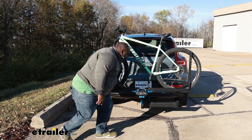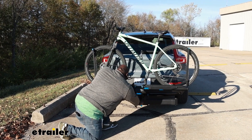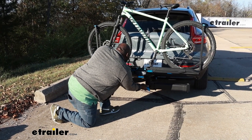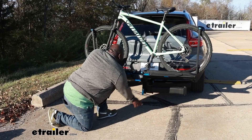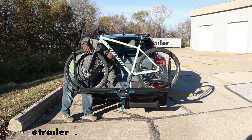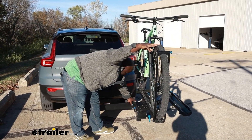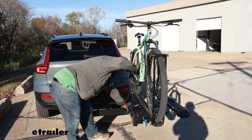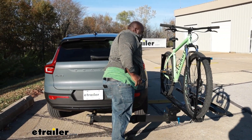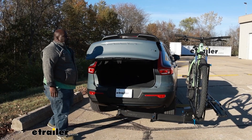One of the main features on this carrier is the ability to swing away. All the Rocky Mounts carriers have the blue aluminum handles where you'll know all your touch points. We're going to start by unscrewing this handle — this is additional stability that keeps everything secure when you're not folded away. When you get that loose, you're going to release the pin back here and slide it out. Right at the hinge, you're going to reveal another contact point, another pin you're going to pull out, and guide the rear of your bike outward — being cautious of a pinch point. That allows you to gain access to your cargo area without unloading your bikes.